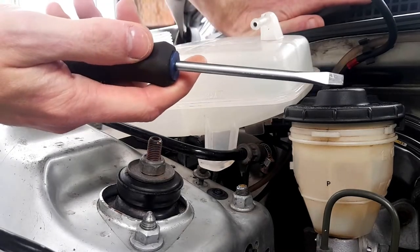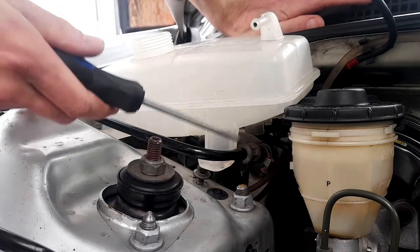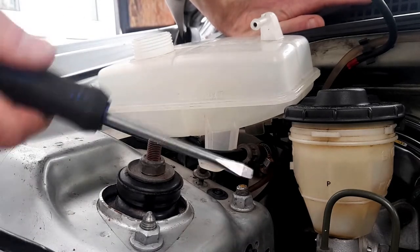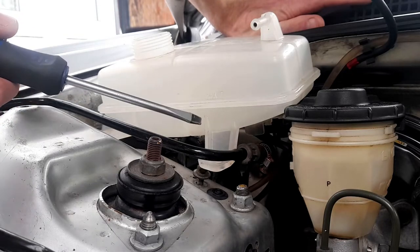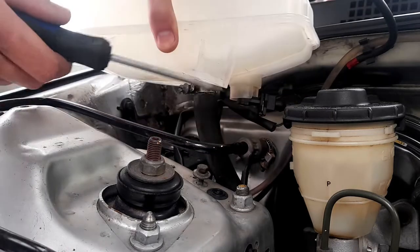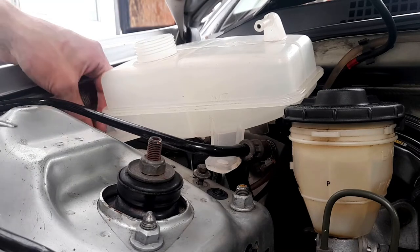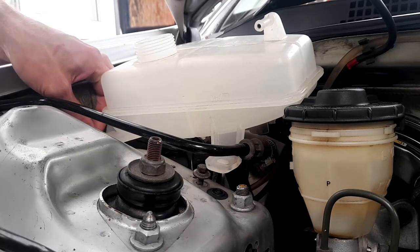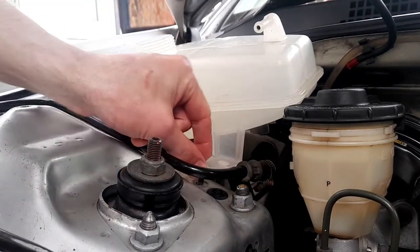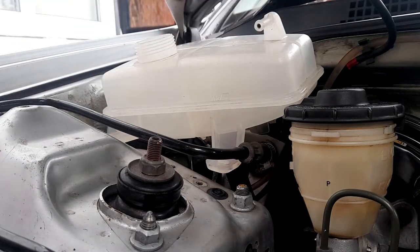And that's basically as much as that is. That's the only reason that I would use spring clamps over Jubilees. The fact that they can't be abused, they can't over tighten or under tighten. The only thing I would say about spring clamps is that they do rust. These can rust just as badly. You need to get stainless steel ones. My argument is with Jubilee clips, either go OEM with Jubilee clips if the manufacturer fitted them, like Rover did with these, which are genuine Jubilee clips. Cheap generic Jubilee clips that you buy on the internet are just not good enough.